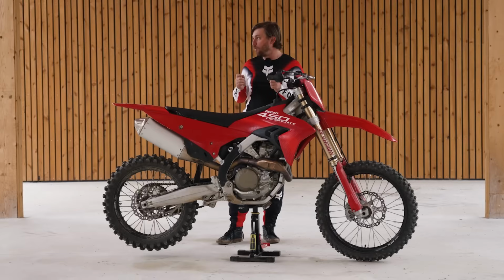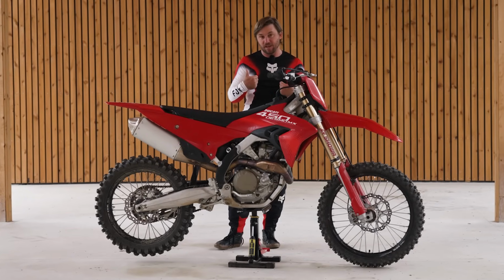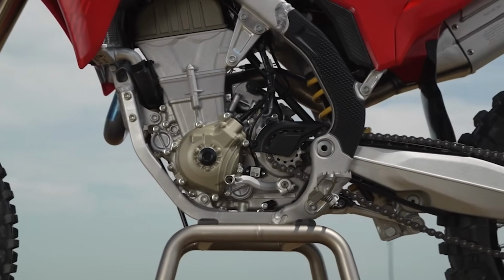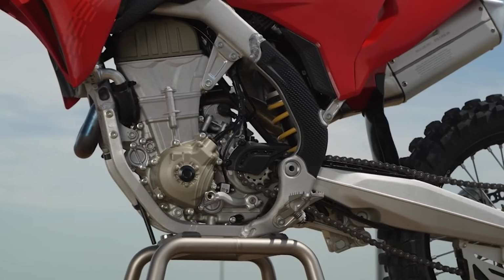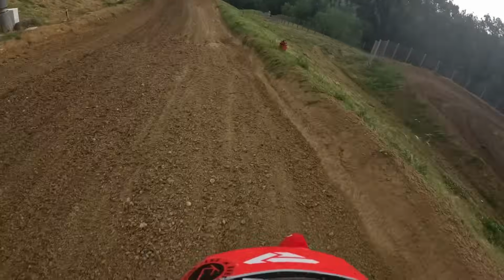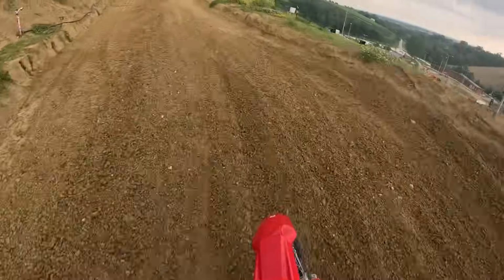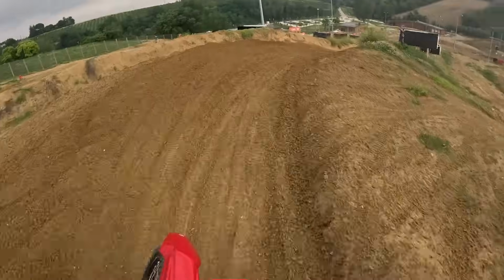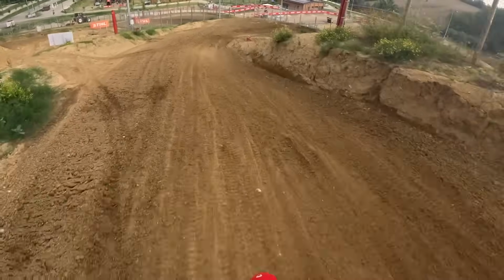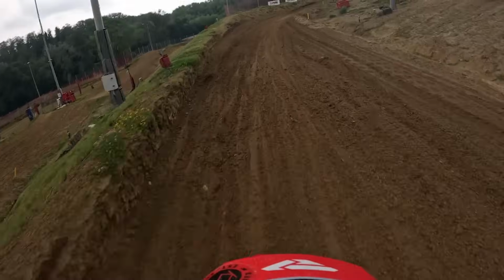This bike, in a way, is actually able to track rear wheel speed, and there is a sensor you can find on the engine side, the left side of the bike where I'm standing. There's a sensor in the case that basically measures the countershaft speed, and based on what gear the bike is in and how fast that countershaft is moving, they know how fast the rear wheel is spinning. So they're able to judge the rear wheel momentum based off of other sensors on the bike that sense the momentum of the bike, and I believe some sort of G-force. It basically dynamically knows how fast the bike is moving and roughly if it is jumping or changing direction. So based on that, it knows if it's jumping so it doesn't cut, or other things that let it know it's not driving in a straight line.